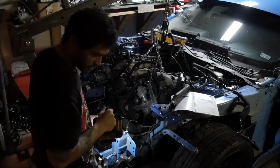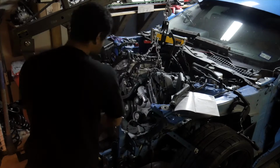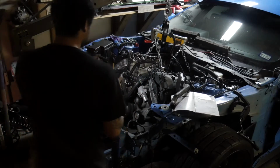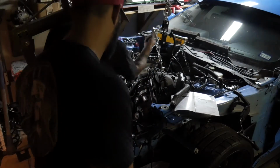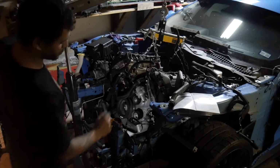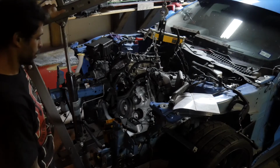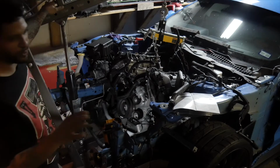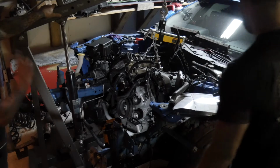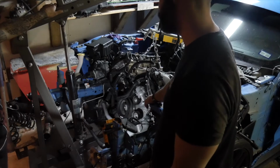I probably should drain the oil and take that oil filter off of there. You got the headers off? Huh? The headers? I have one loose. The one on there is just floating, but it wouldn't clear. To get those bolts off, you have to take the motor mount off. Shit, that's what's hitting, the oil filter over here. You know what? I'm pretty sure you can just take the oil filter off and the oil is not going to continue to drain out of it, right? Because it gets pumped through. Since it's been sitting for as long as it has, everything should be in the pan. Yeah.